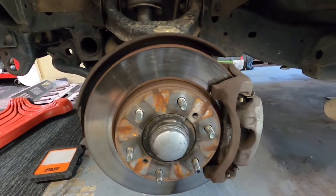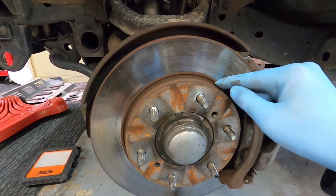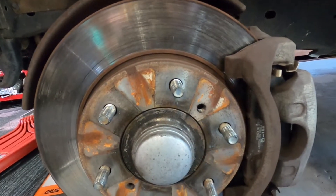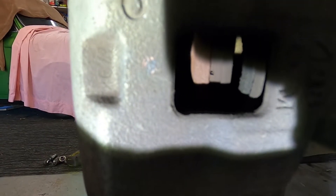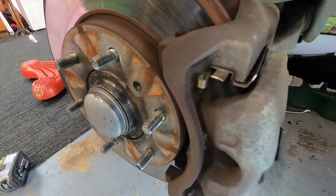Now that we've got the wheel off, it's time to check our brakes. Check your disc - make sure it's pretty even all the way across. We don't want a big lip on the edge. If your disc looks like this - nice and straight across with no major grooves, just a few small ones - there's nothing to be concerned about. You can look in at the pads - this one's probably got about 40% left of its pad life. The inside pad has about 50% left, so this will probably be due around another 10,000 kilometres.